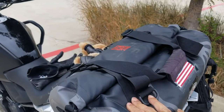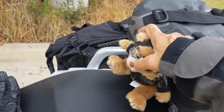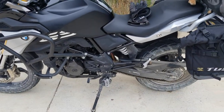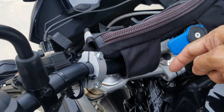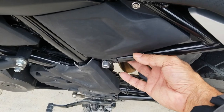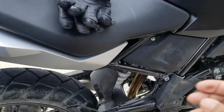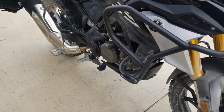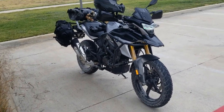I have a top case with a Walmart box that will stay on for regular use. I ran the USB port wiring through and connected it as a pigtail from the battery, and on the other side I have the pigtail for my battery tender. So that's the full setup on this bike — it's all set up and good to go for a full-fledged BDR.